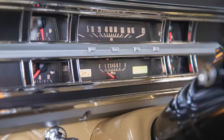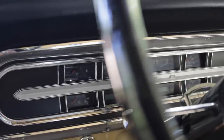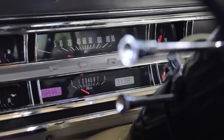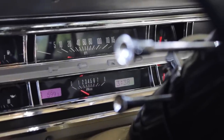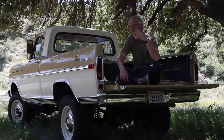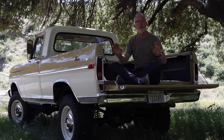For gauges, as you're already aware, we often work with our friends at Dakota Digital. This is a Dakota Digital dash module that fits into the stock enclosure. It keeps a very vintage stock aesthetic, but it's LED-backlit and features lots of functionality the original Ford designers never could have dreamed of. We can do quarter mile, zero to sixty, multiple trip meters, metric — all sorts of ways of reading information, all the way through to integrated four-wheel-drive light, parking brake warning, check engine light, high beams, and all that. Still keeping it really smooth and retro.